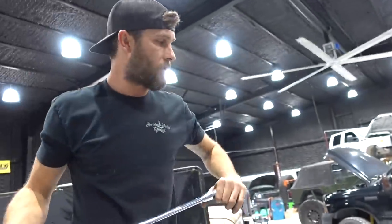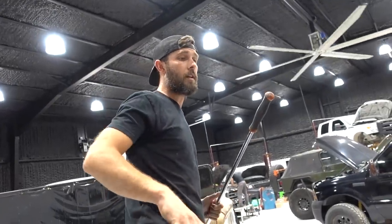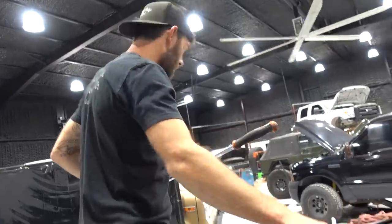There's zero. This is important because the computer is gonna control all the ignition. So if you've got it at zero and it knows it's at zero, then it can adjust all the time accordingly. Now that we're at zero with our rotor,